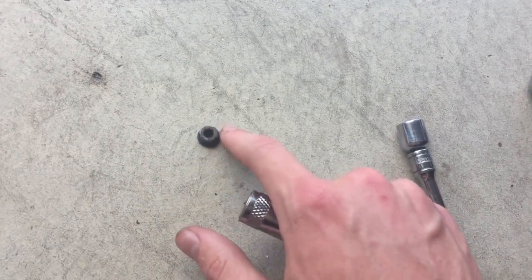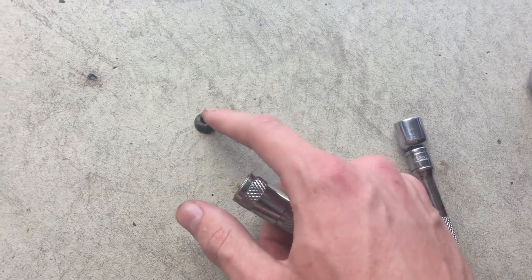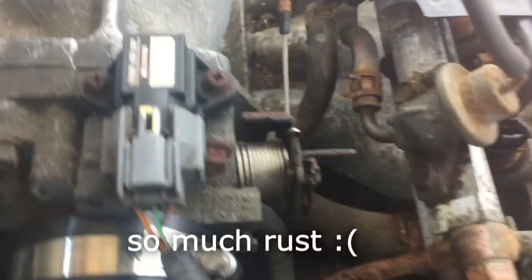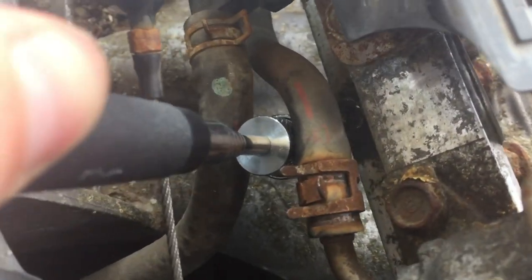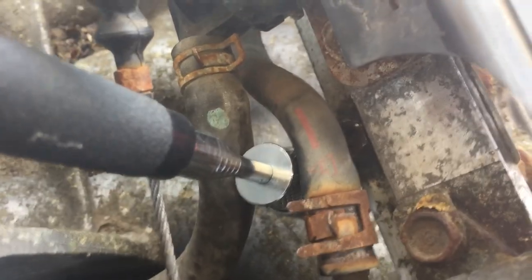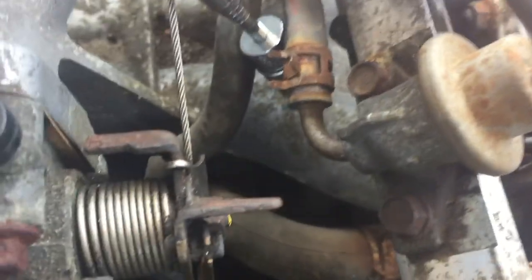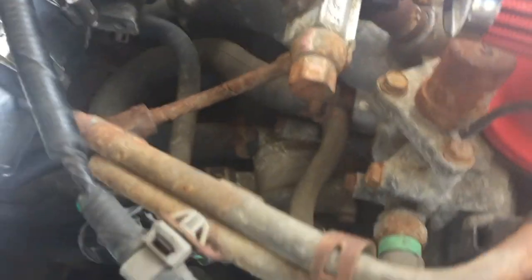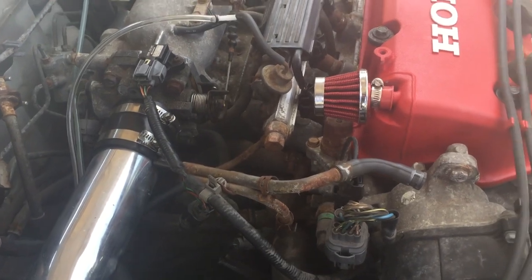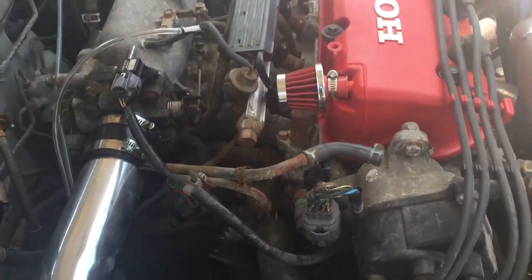If that doesn't work, it's probably the o-rings. That's my guess. I'll just have to take those out, wash them out, dry them, make sure they're super dry, put them back in, and that should work. Let me find the spot — it's the bolt right under here. That's the culprit. I can't tighten it down, so I think that's why it's leaking gas. My other guess is that it would be the o-rings on the top side of the injectors, where when I took them out I had gas over them and I did not clean them off when I put them back in. So I think it's one of those two reasons. Hopefully it's nothing else because I need to get this to the shop so I can get it tuned.